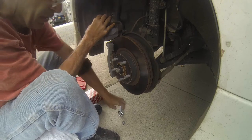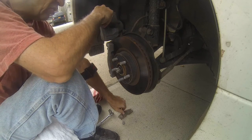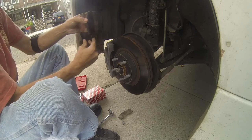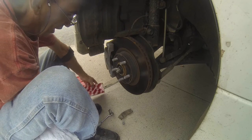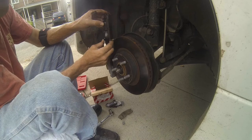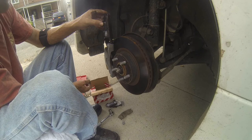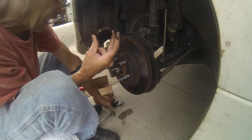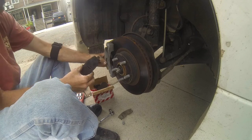So I have my options — anybody can do this. Your shim is going to come off; place it to the side the way it comes off. There are two shims. Just pull the pad out and away. You can see I still have some life to the pads. The question is how much life do I have to the pads. That is the life of the pads right there — I've got about 5,000 to 10,000 more miles to go, and I am going to be changing these out in the fall. So let's put everything back together; we have inspected our pads and they look pretty simple and easy to do.